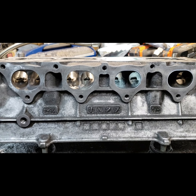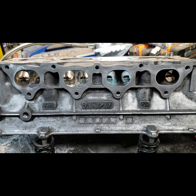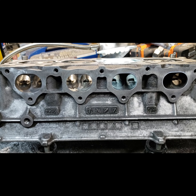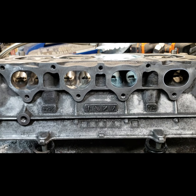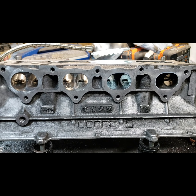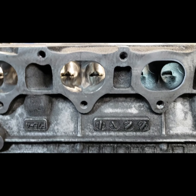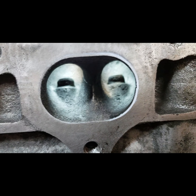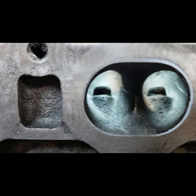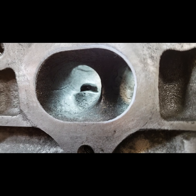I started working on the B20 head. I wasn't planning on porting and polishing this thing, but the more I thought about it, since I have the engine off and torn down anyway, I figured I might as well go to town and get it ported. It makes the engine safer too — just doesn't create hot spots. Here are the ports before porting — they look pretty rough because there's a lot of carbon deposits still in there, but you get the general idea of the shape and you can see all the casting marks on the sides.